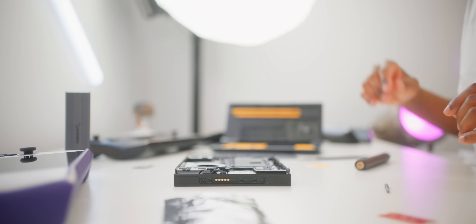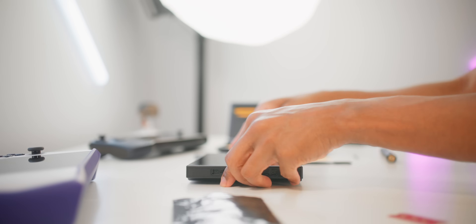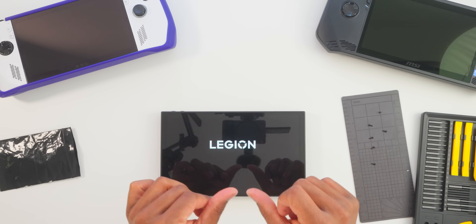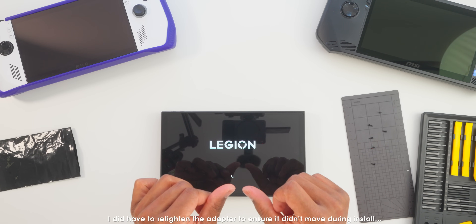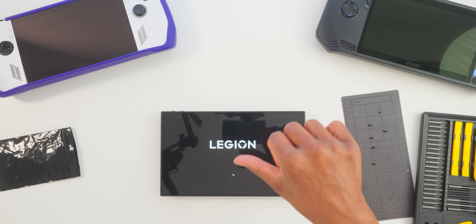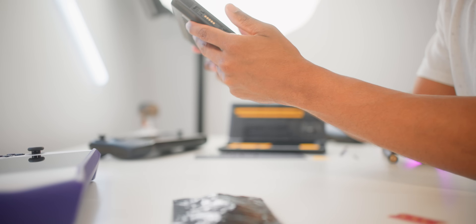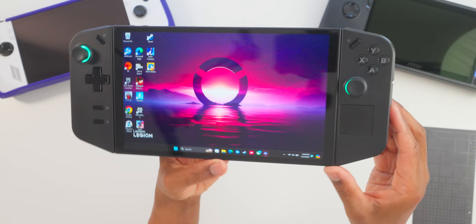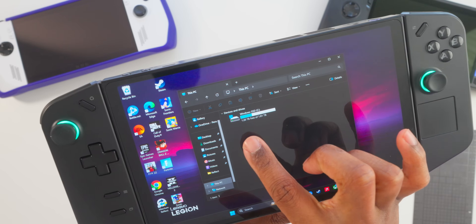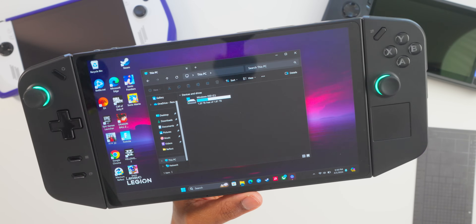Before I accidentally power this thing back on, I'm going to put the backing onto it and test it. Let's see if we get a first boot with success — nerve-wracking. Be careful with that adapter when pushing it in that it doesn't get unseated; it can give a little to the left or right, so push evenly at the mid-tier where the actual 2230 is. As you can see, this thing booted right up. We are fully running, no different than how it was on the 1TB. Going to This PC — you can see 1.2TB free of the total 1.81TB allotted out of that 2TB WD Black hard drive.